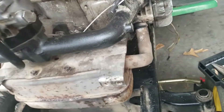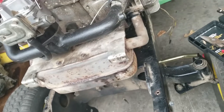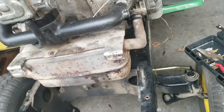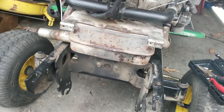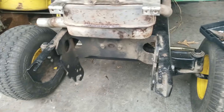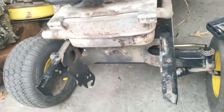You're probably thinking — if it was running right, why is this a problem now? Well, I rebuilt the carb right after that and then replaced the sump gasket because it started splooging oil everywhere, all over my driveway. I guess it finally blew out from age or something. Basically all the oil I had to add just drained right back out. It's been sitting for about sixteen to seventeen hours now and it has no leaks. The crankshaft looks okay — doesn't seem to be any oil on or beyond the seal. I was worried about the oil seal on the crankshaft because I didn't replace it, but it looks like that was actually okay.